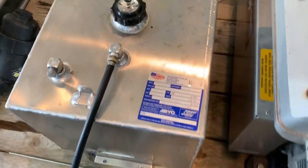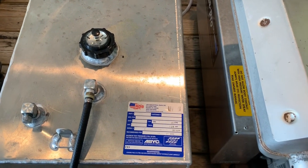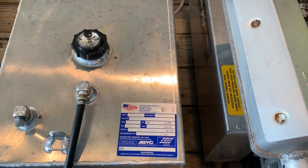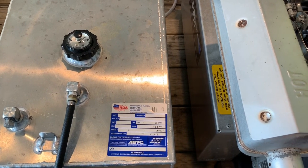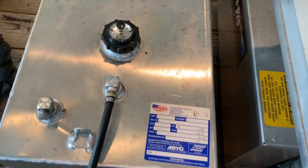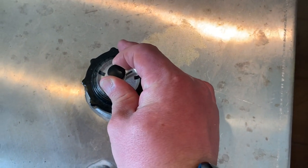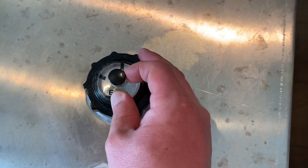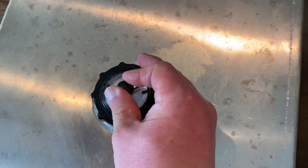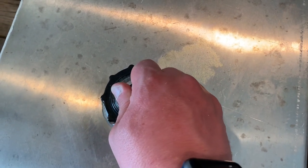So the gas line runs in here. Funny story — out here in Oregon, other people have to pump your gas for you. I think it's actually against the law to get out and pump your own gas. So anyway, this gas cap here is screwed all the way out so air can get in, and then you screw it in. I think when the guy was pumping the gas the other day that thing got screwed in and there was no air, so there was no way this tank could breathe. The little bit of air that was in there got sucked out and caused the engine to die.